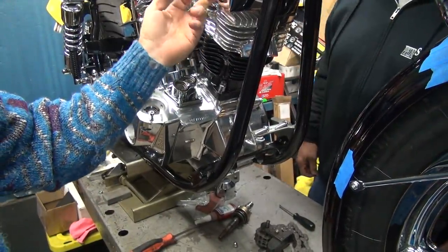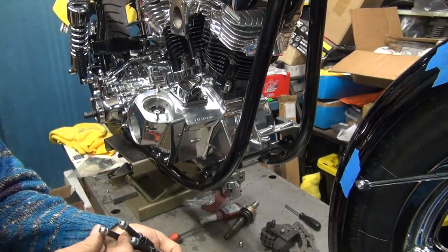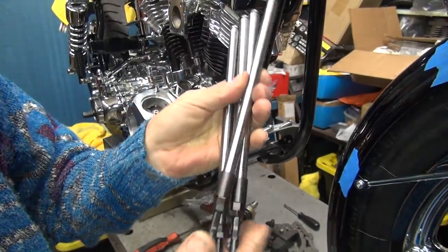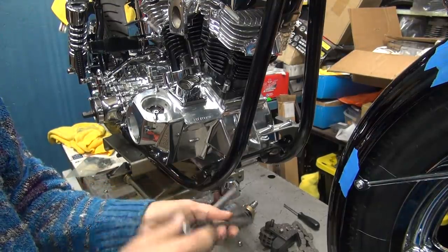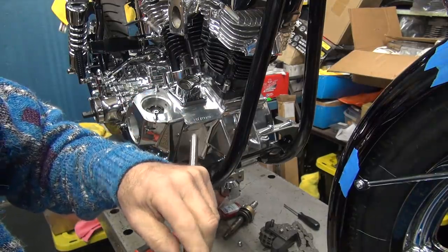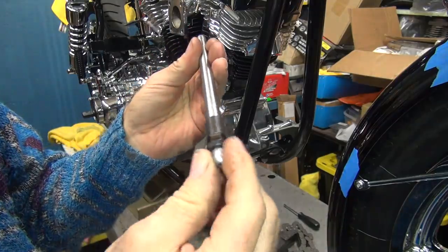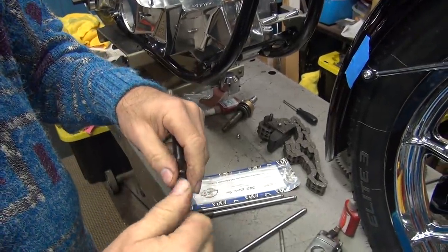Okay, we have no seals in here yet. So here's your push rods. You have S&S rollers up in there? Okay. We can either run through-the-tube oiling or not on the lifters. Right now everything's opened up because you've got oil lines going up there. And I think these go all the way through too. So these are internal oiling also. Yep, they blow through. So I don't think it matters if you have oiling from both directions.